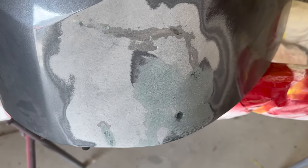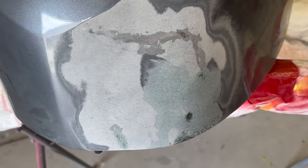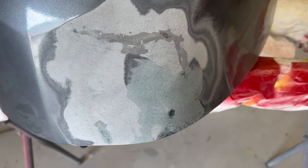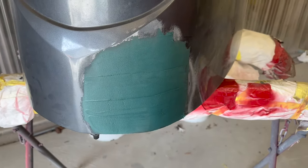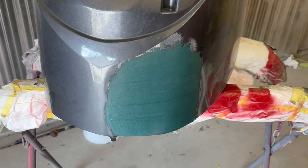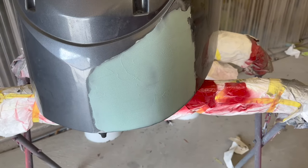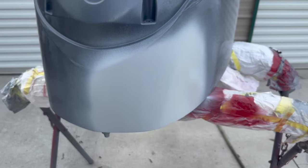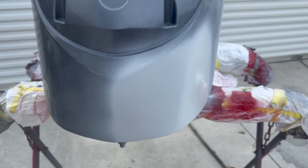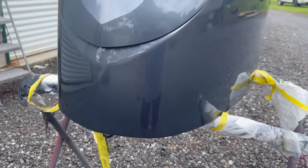Here's what we got — I zipped it down with a DA real quick with some 80 grit, still got a hole right here. I'm going to go ahead and wipe some more glass on it, try to fill that hole in. For this one I switched over to short strand fiberglass for this wipe. At this point from now on it's pretty much just a cosmetic repair like you would anything else. Moved on to Bondo at this point. Got it all primed up. We're gonna go ahead and paint this thing. Here's the final product — thanks for watching, hope you guys enjoyed it.